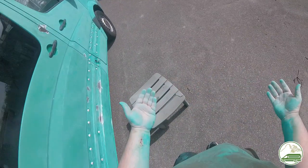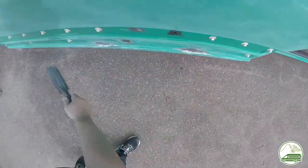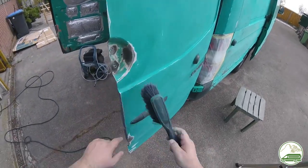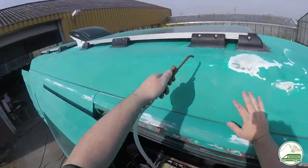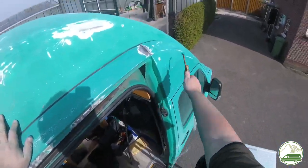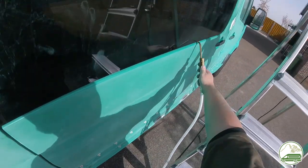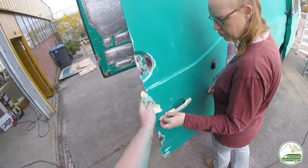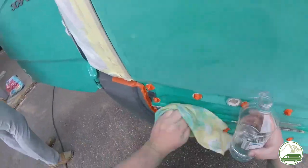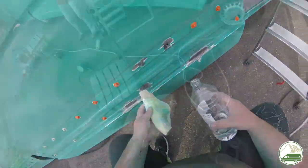What is also important is cleaning and degreasing after sanding the van. First the dust needs to be removed as much as possible — we tried a brush which works but is time consuming. We had a compressor available so we tried blowing the dust off; this was a lot faster, and using compressed air was especially helpful to get all the dust out of the nooks and crannies quickly. For degreasing we used the UPOL slow-drying degreaser S2002-5 — we bought a 5 liter can. We started using pieces of cloth to apply and wipe, but as the van is massive we switched to using a regular spray gun to apply the degreaser and then wipe the van down. After every step of sanding we degreased again.